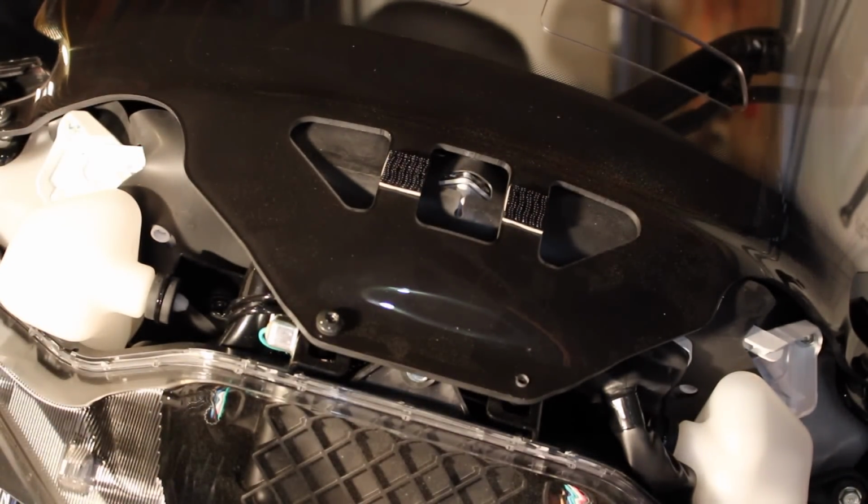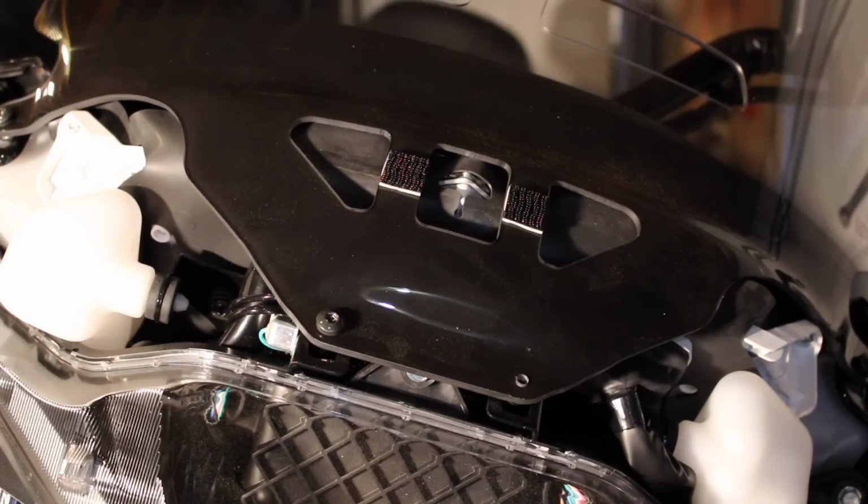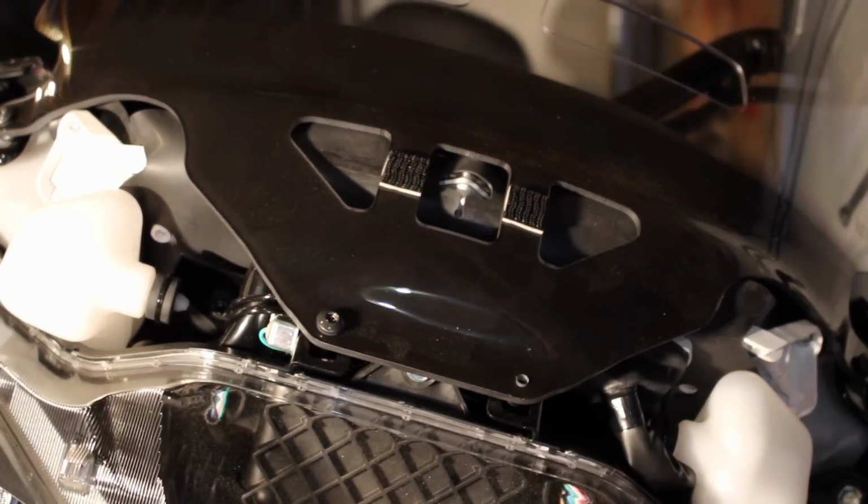And you're going to repeat that step for the 4 bolts. And then you just pull the windshield off. Like I said, if you get to the hardware store and get this tape and cut some new pieces, you can interchange between the 2 windshields, because you'll leave the locking the same on the back of that front cover, and these 2 pieces will remain on the other windshield. So then you can just swap windshields in and out, which is pretty easy.